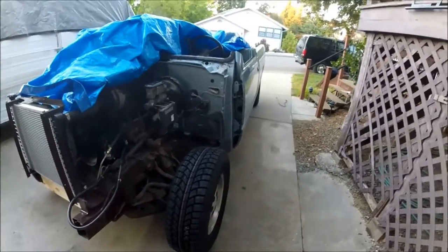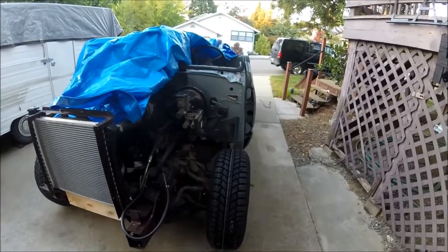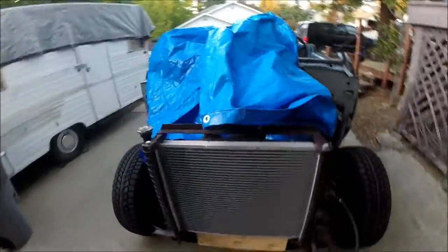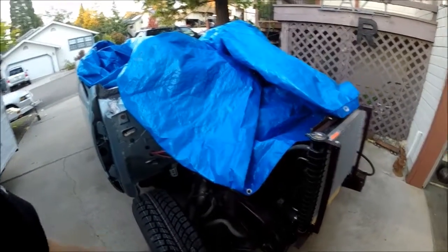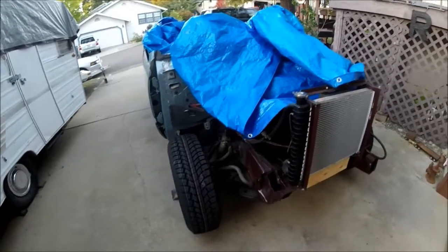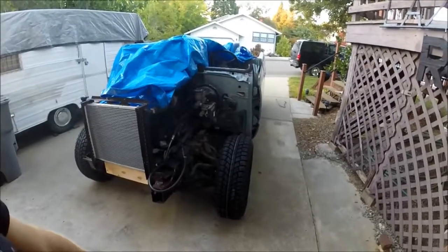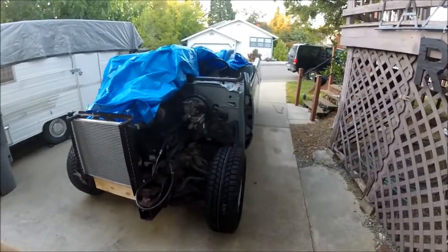But these are handy too, having the stripe on there. I got to verify the wheels are all straight, nothing's bent from the wreck. But that red stripe will be a big help setting the toe on this thing. I looked at the truck there yesterday working on it, and standing overhead looking down, the front end is pushed back on the right hand side, and that's not any surprise, and the frame's turned in here a little bit, so the tie rod on this side is pulled back, so that's why the toe is way out. So Ackerman's probably way out on it too, but hopefully that won't affect things too badly. But we'll be able to get the toe straightened up here. This side's got some crazy looking camber going on, I think, so I don't know. We'll double check that and get them halfway straight up and down.